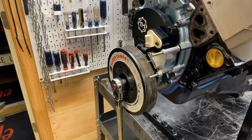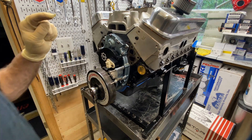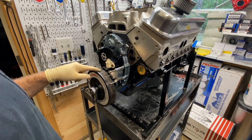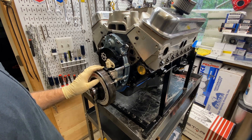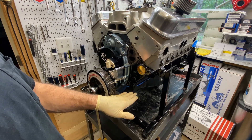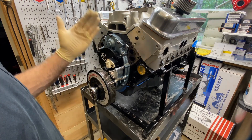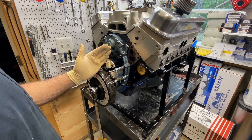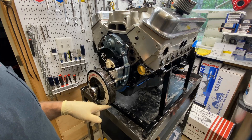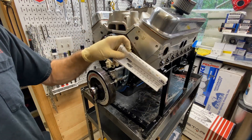Got that done. One tip: these dampers won't have timing marks on the other side of top dead center usually. So if you find with a piston stop before top dead center, and then turn it around and find with the piston stop where on the other side of top dead center, you won't have timing marks — you'll have to go by your own measurements. What I use is MSD timing tape.